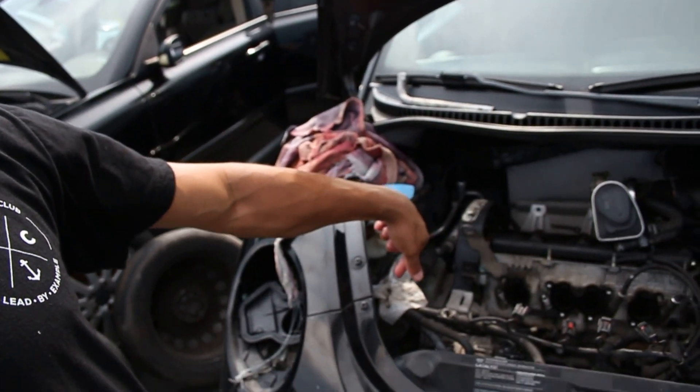I still need to go to the parts store to get 16-gauge wire to extend my MAF sensor from one side to the other, a freeze plug to block a hole in the bottom, and o-rings for the Mark 3 injectors. I can't use the Mark 4 injectors because this car is from 2004 and the injectors and fuel rail are different. Also, it didn't rain one bit while I was here — it's been dark the whole time but no rain, so Florida was on my side today.